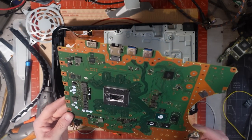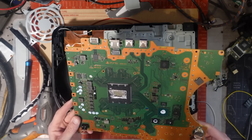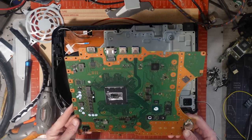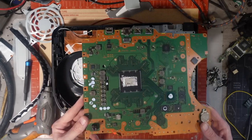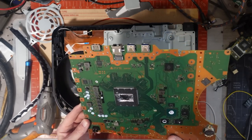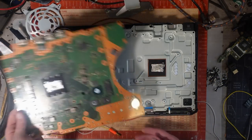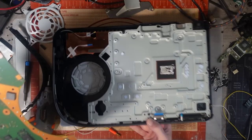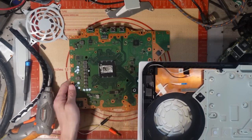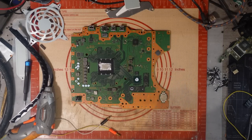And yeah, a little bit of a splatter on the liquid metal. Nothing major. The one thing I'm more interested in is, number one, do we have any cracks on the board? And number two, do we have any chips on the APU itself, as in the corners? Because that's what tends to happen when these get dropped. They're really not very well protected. I don't think we do. I will just inspect it under the microscope. I've got bits of plastic falling out the case as well.